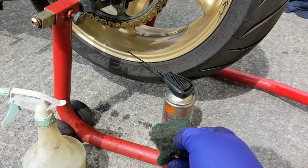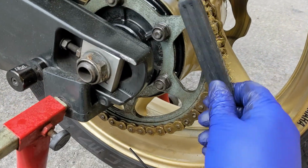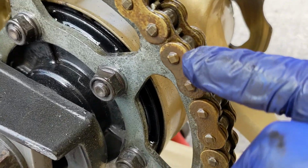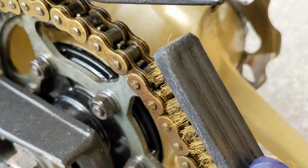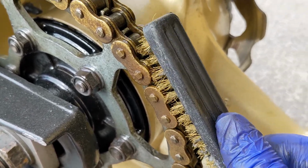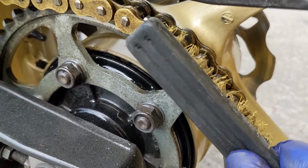So you're saying you don't have any Scotch-Brite? Okay, well, you can use these little brushes. Sort of brush you might use for cleaning spark plugs. You can use them, it's okay. And you can see the O-rings are sandwiched between two pieces of metal, yeah? As long as I'm not applying pressure this way, and I'm applying pressure this way, I'm not actually touching the O-rings at all.